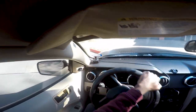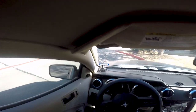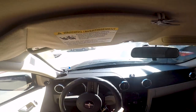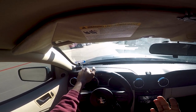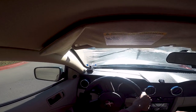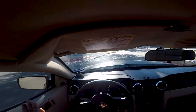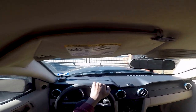Even though I'm more than likely going to buy a new alternator soon anyway, just to prevent that from happening when I'm all the way out away from home. Okay, so the battery light hasn't come back on at all. And usually, after starting up, after maybe 3 or so seconds, it'll pop on, and once I start driving, it'll go off until I'm at a stop or I start decelerating, or I'm no longer giving the gas, is a better way of putting it. And it hasn't come back on yet, so. Ooh, that left my trunk. I don't know, we'll find out some stuff start flying up.